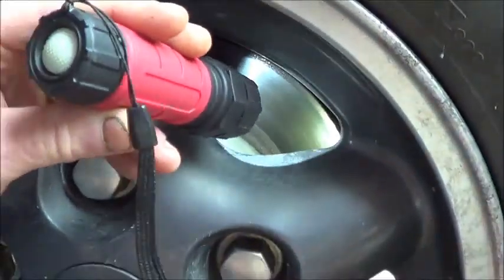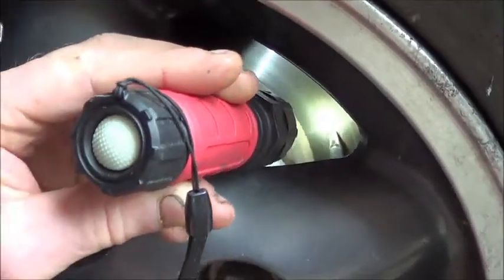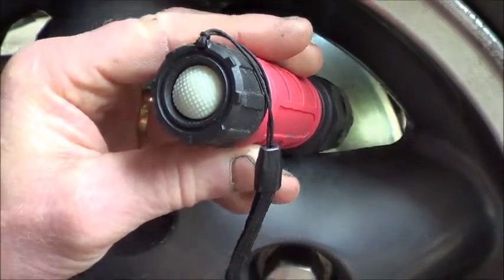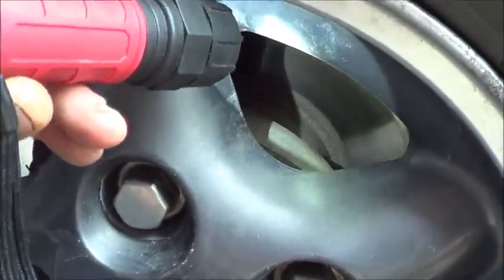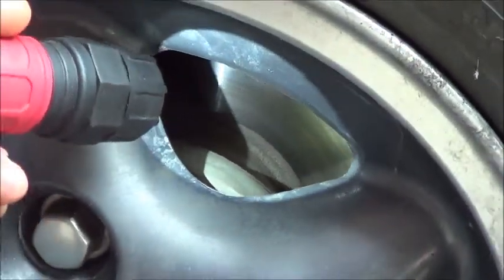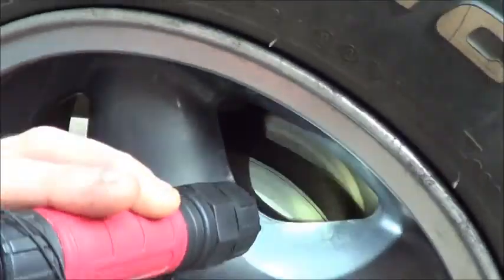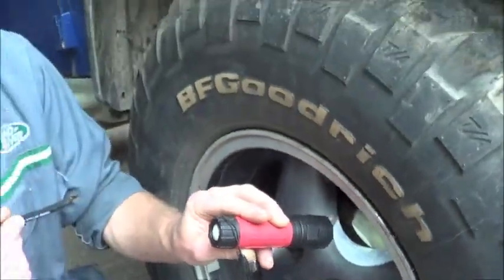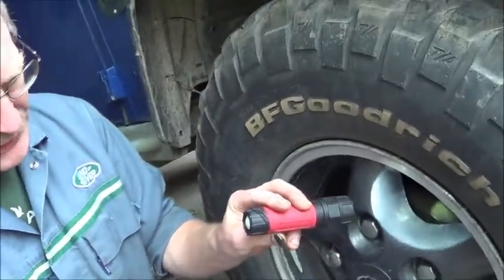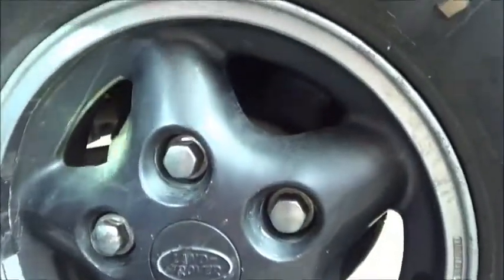It's not advisable, but it is possible to have a band of rust up to here and this part being clear, and that would still be acceptable. Now that's from the test point of view, but that's not necessarily acceptable from my point of view. I have to follow the rules. You don't want to mess around with your brakes — you've got to start thinking, do I feel happy? Is it safe? Do I want to drive this? Those I'm pretty happy with. They look nice and shiny. They're fine.